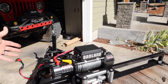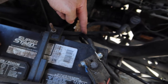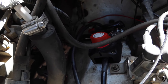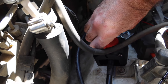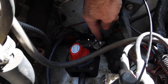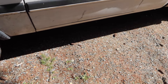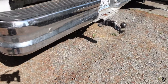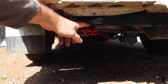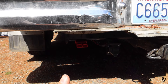We're going to have to hook it up to the truck to test it. We've got our negative and positive here, running to our battery disconnect switch which is currently off. I can flip this on and have 12 volts at the back of the truck, flip it off and there's no voltage. I also put in the 50-amp breakers that came with the winch, and our positive cable runs the whole length of the truck, zip tied up nice and tidy, connected right next to my trailer hitch wiring. All I have to do is plug this in, turn the battery switch under the hood, have the truck running, and the winch should be good to go.